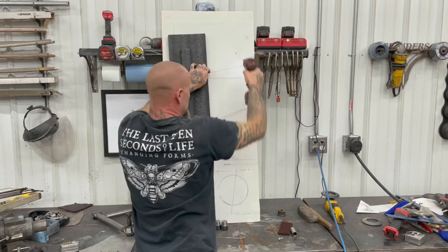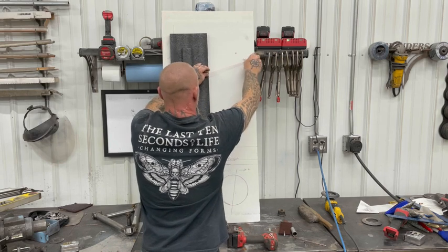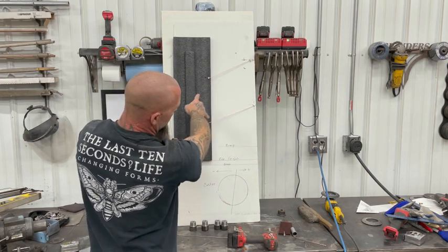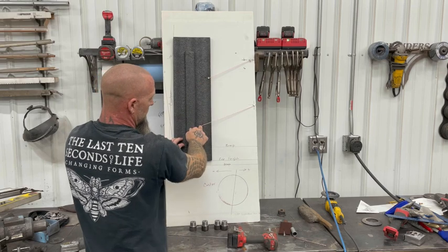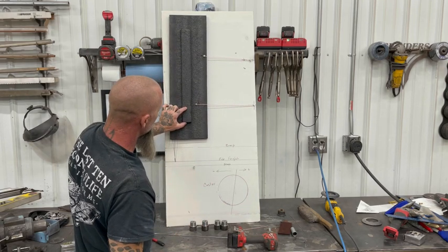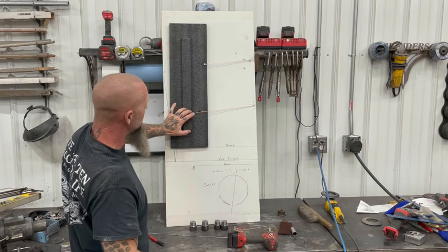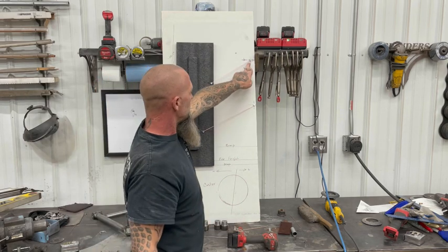So let's do it again. Let's try something else. Let's go to a longer arm now, and we'll change our mounting location again. So now we're getting a little more symmetrical. These two are parallel, which is probably going to be one of the bigger points of the entire thing. This arm is 2 inches shorter than this arm, where this one was 3 inches shorter. Now, as we travel, you can see this is our level bump line. This is our level ride height line. This is our level droop line. That tire stays 100% level. We don't gain or lose any of our camber just by adding 1 inch and changing that location.